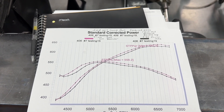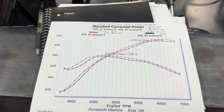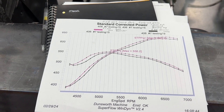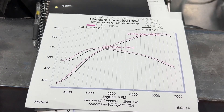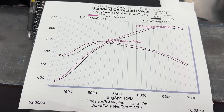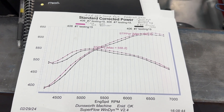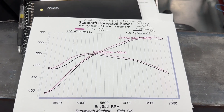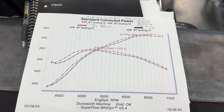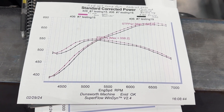So I got really frustrated. I changed jets again, this time going to the biggest jets in the BLP kit, and the air/fuel ratio still stayed at 13.2. Chances are it wasn't pulling more fuel from the jet — it probably needed an air bleed change. But I didn't have any air bleeds, and since this wasn't my carburetor I didn't want to mess with someone else's beyond simple jet changes. It's also a three-circuit carburetor, so I'd have had to change probably two of them. The air/fuel ratios were consistent all the way through — total of about 14 jet size changes all the way around, and it did nothing.